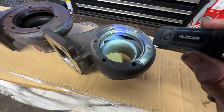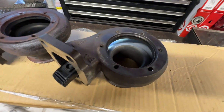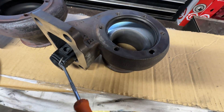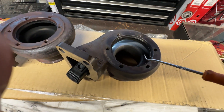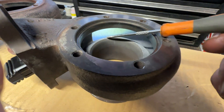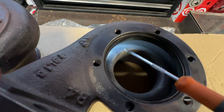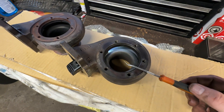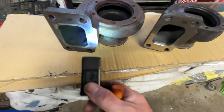I'll show you — have a look in here. So what we're looking at is, see this nice rounded edge here? Your exhaust goes in there, comes around here and spills over into the turbine, goes around and then goes out the exhaust. You see this nice rounded edge, particularly here, round to about here. And this is what you pay for when you're buying a genuine Garrett housing versus a Chinese one.